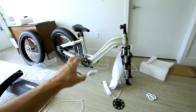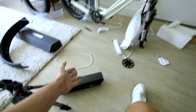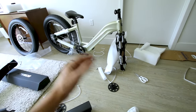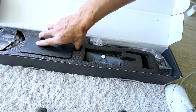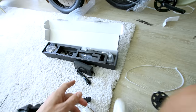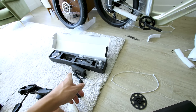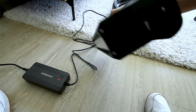A big battery pack paired up with a torque sensor is a great combination. The torque sensor gives you power based on how hard you're pedaling, which controls the power a lot better. The charger is a 3 amp charger — so 20 divided by 3, it'll take about six and a half hours to charge from empty to full. A 3 amp charger is much better than the typical 2 amp charger on a lot of bikes — it charges the battery 50% faster.